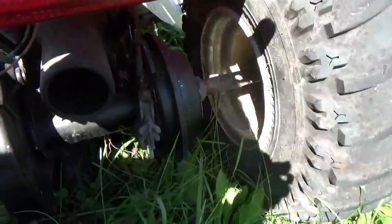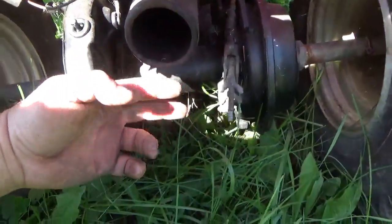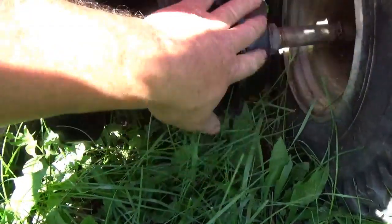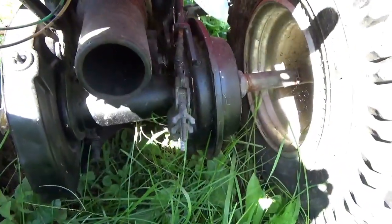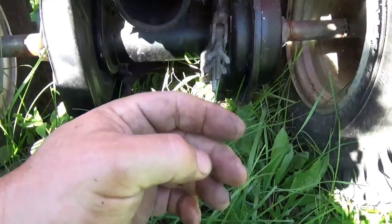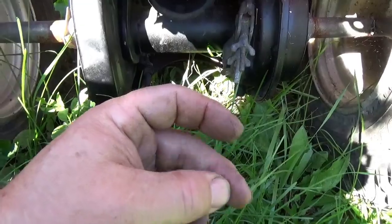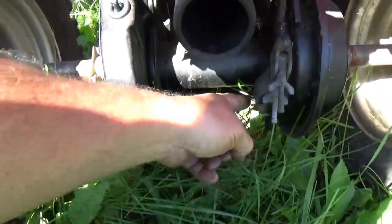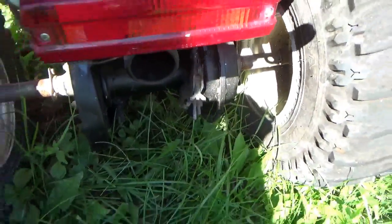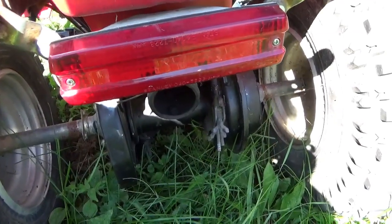And back to that dipping it in water stuff. When you get water in here, the bolts go through and actually stick into the brake drum area. So when you have water in here, the inside gets rusty. So as you go to back them out, right, you got this whole rusty area that has to go through the threaded area, and most of the time they break off, but not in a good way. And let me show you.